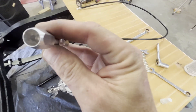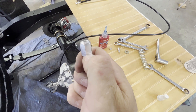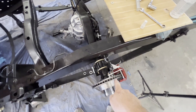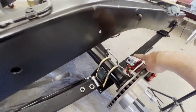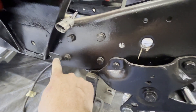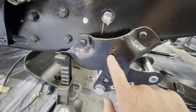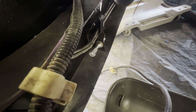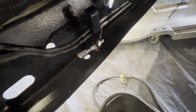If you look down inside this cable end, it's about 3/16ths of an inch from hitting the bottom. So I'm going to set you up, put my cable in the caliper bracket — all it is is put your cable through, put your nut on the back side, and tighten it up. We're going to run back through our hole on the frame, put our cable clamp there, and measure and cut our cable. Then all we have to do is get the steel braided cable through, measure it, and get it hooked up.